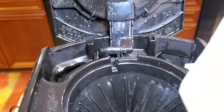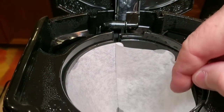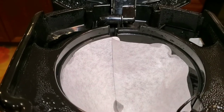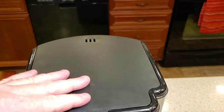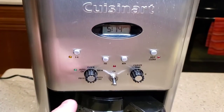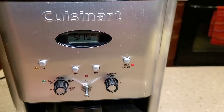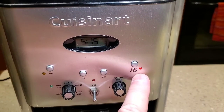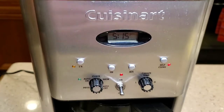They also say you can use a paper filter. You don't necessarily have to, but it's nice to see the calcium deposits — it's going to stop them and they'll collect in there. Then make sure you close the lid. We're going to leave this switch in the brew position, press this self-cleaning button so that light comes on steady, then move the switch up to start the brew process.